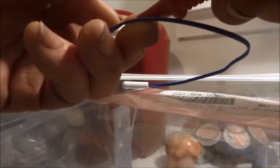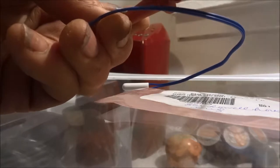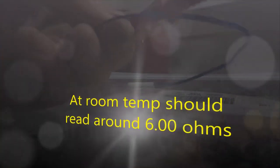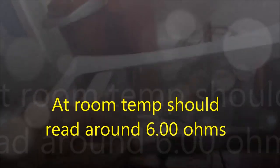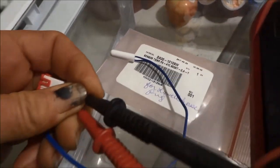This fridge actually took me two hours to repair. The defrost tube was really frozen. The defrost tube on these particular Samsungs is problematic, and I will stick a wire down there and wrap it around the heat element to solve this problem.